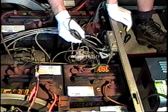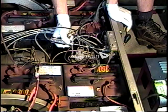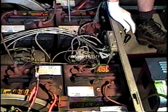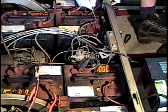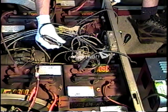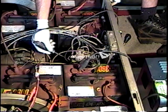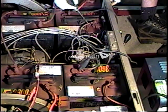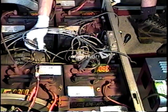The wire comes from the negative, through the forward and reverse mechanism, through the key switch, and to the negative terminal on the solenoid. To test that circuit, you wind backwards from this point to the key switch, through the key switch, through the micro switch on the back side of the forward and reverse mechanism, and to the negative post. The positive side is switched — so if we move our clamp to the negative terminal on the battery and probe the positive terminal, and then activate the foot feed, you'll see the positive current come to that solenoid.